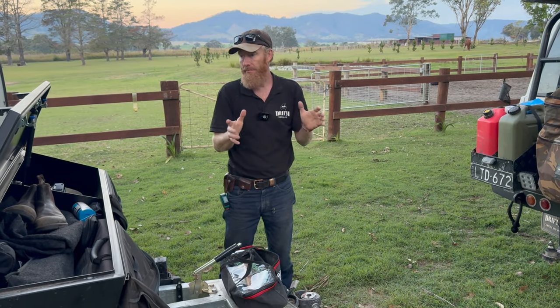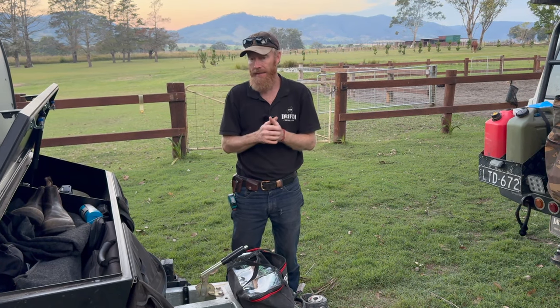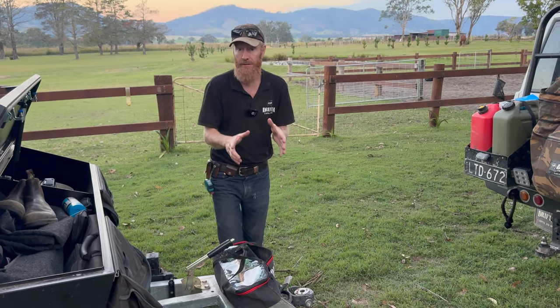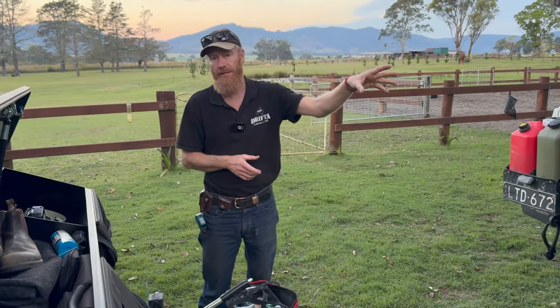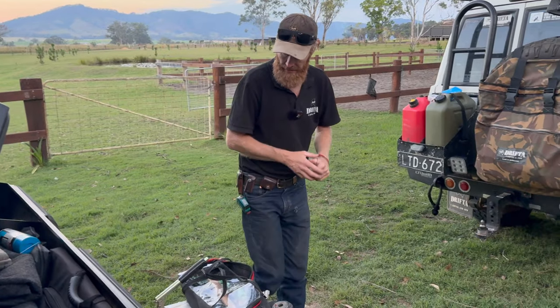So just keep an eye on that if you do have a lighter vehicle and you find you may need it. It's probably recommended to consider sway bars for more than 150-200 kilos on the tow ball. With a bigger extended vehicle like the 79, a heavier vehicle, maybe not so much needed, but something to consider having sway bars even on a van this size.